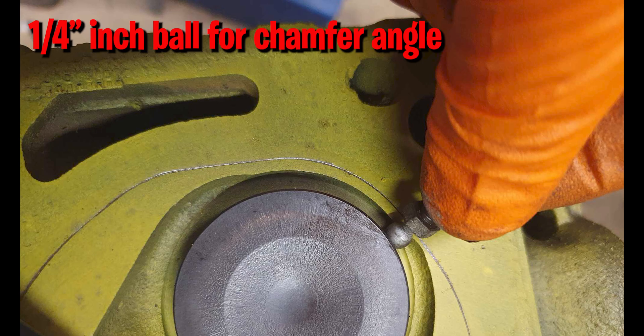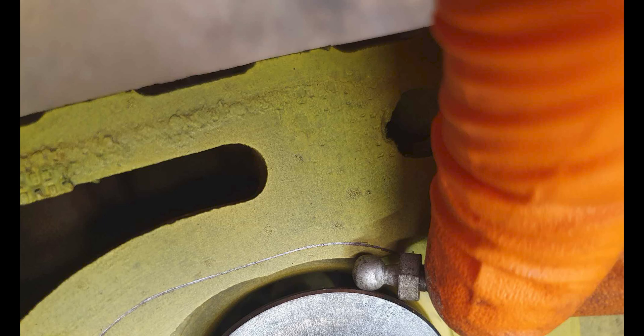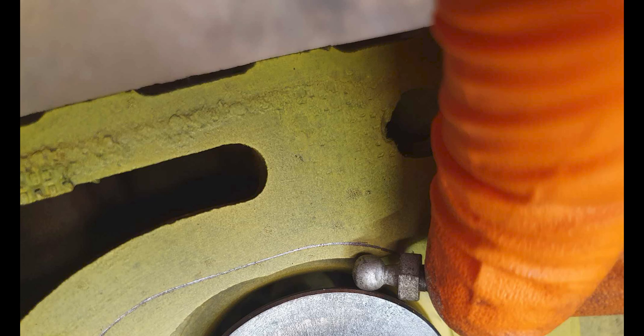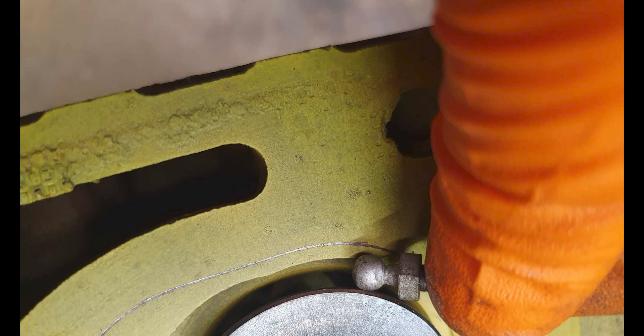Craig is showing what simple tools to use to find our chamfer angle — everyday stuff you'll find in your tool shed. For example, a carburetor rod ball. The key thing is that the allen key and the ball — even if it's a ball bearing welded to a little stem — must be a quarter inch in size. With the allen key under the valve and flat on the face of the cylinder head, you use that little quarter-inch ball to run around the valve. Where you find the ball will not fit in between the seat and the valve, you'll know that area needs de-shrouding, but not exceeding your head gasket mark. That's where you begin your de-shrouding process.